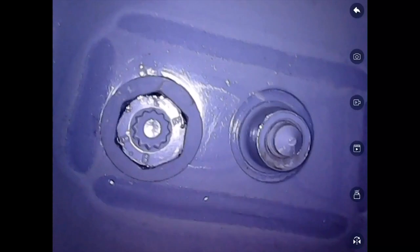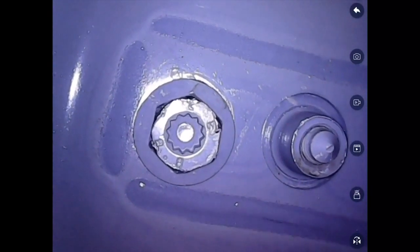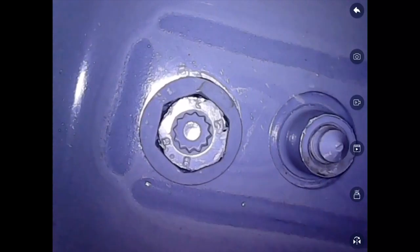See, you have your fuse box, up here are your relays, and up here you see these blue relay female connectors. They're not being used for my car. My car is a Jetta S, so I don't have these features, I guess. So there wasn't anything installed in here. But there were these blue tabs sticking out like spikes, four of them. I took a pair of pliers and just snapped them off to get more access to this spot right here. Basically the screw is right in the spot here, and you make a left, and you go down, and right there's a screw. So that screw you unscrew in order to take off the upper hinge that's actually on the car.